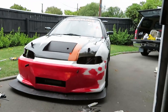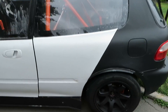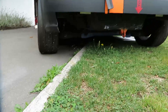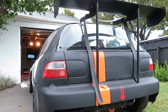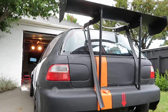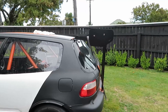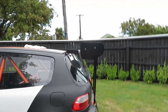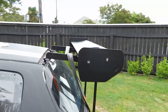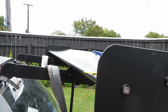The next stage will be running a flat floor and a diffuser. The first part of the splitter will come roughly here, then I'll plan a center section, and then begin the design of a diffuser of some description. I may also look at how the wing is mounted. I have a feeling the new front aero setup is going to be extremely effective — possibly rendering the wing less effective — but we'll wait and see. I've still got plenty of angle of attack I can add into this wing; it's set as low as it can possibly be at the moment.